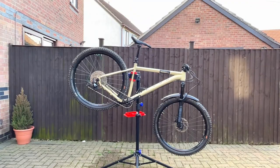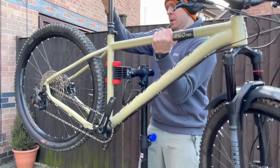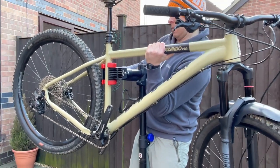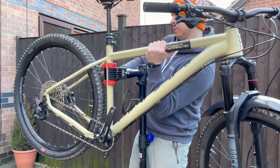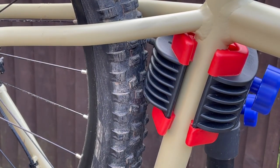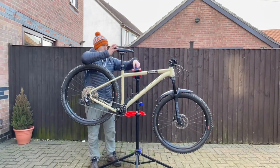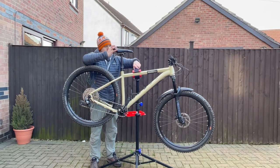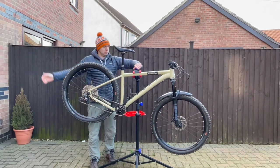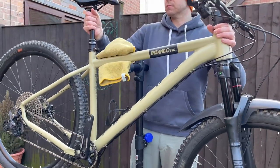My personal preference would be to clamp it on the seat tube, but practically this doesn't tend to happen. For one thing it's super awkward trying to hold your bike in the air with one hand while you try and tighten the bike stand clamp properly with the other. I also find that this gets in the way of the tyre, making it tough to actually work on your bike. So my preference is to clamp the top tube — it's simple, easy, and cuts out a lot of the faff. It also means you don't have to do the clamp up quite as tight as you might on the seat post or dropper. You can even put a rag in the clamp to stop it from scratching your frame.